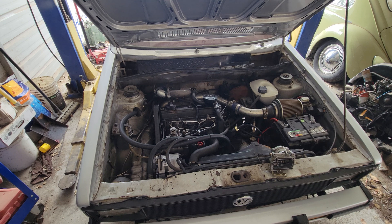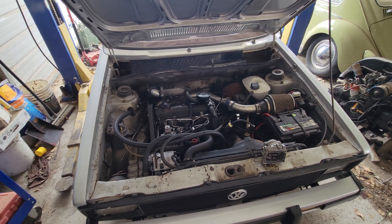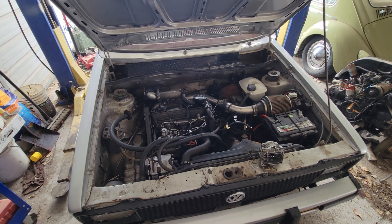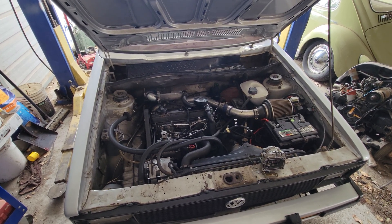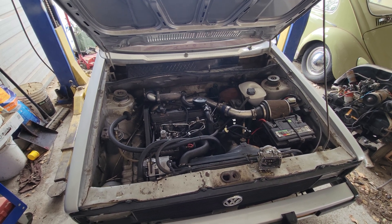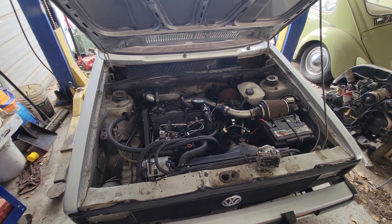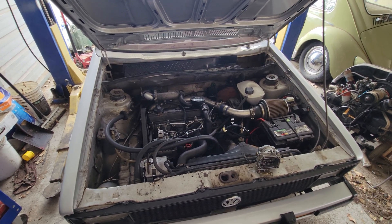Anyway, that's a little about coolant. For people on the road wondering if they can put tap water in — please don't do it very long because it will be bad for your water pump. It will start to get deposits in your engine very quickly. Get that water out of there as soon as you can and put 50-50 coolant in it.